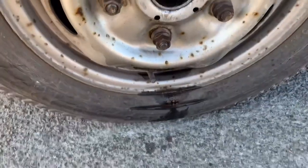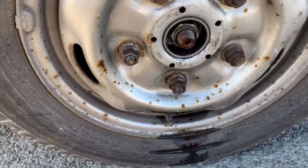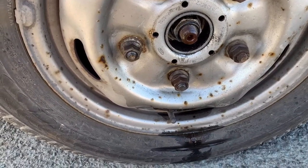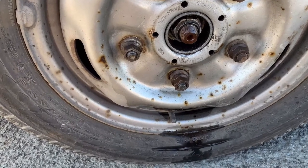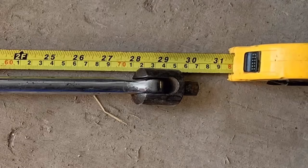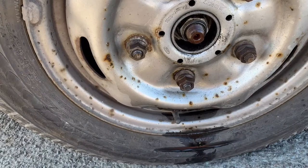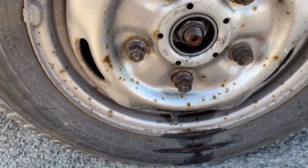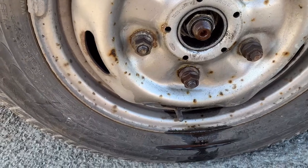With the wheel on the ground, I'll crack that loose with a breaker bar on a fairly long end. I'll put a picture up. There's going to be a bit of bow in it, but you'll just have to persist, because this is torqued to about 300 newton meters.